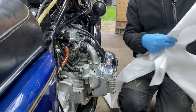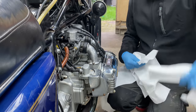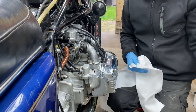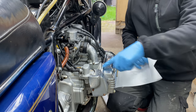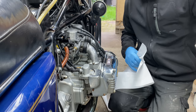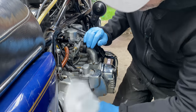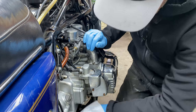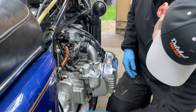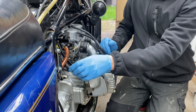You've got to have four pieces of cloth or paper at the ready because you're going to stick those in the intake holes to prevent stuff from falling in. Use these pieces to get rid of the fuel spillage as well. So airbox is off, fuel is off, the intake boot bolts are loosened. Next we're going to loosen the boots.